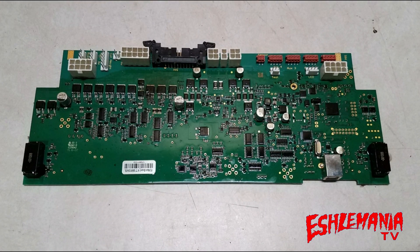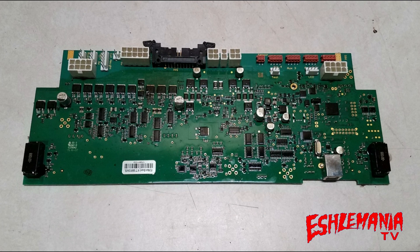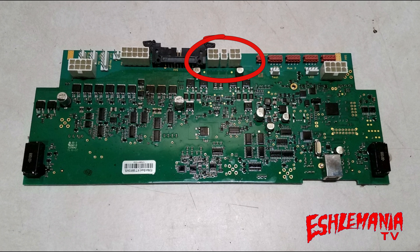So what is the big significance to this? Are you one of those people that has a 430X Automower and you're wondering how to put a second battery in it, or why that second battery does not work and you keep getting an error message? Well, because as soon as you enter that serial number for a 430X into this main board, it tells that mower it is a 430X and can only ever operate as a 430X should — meaning it knows it is only allowed to have one battery.